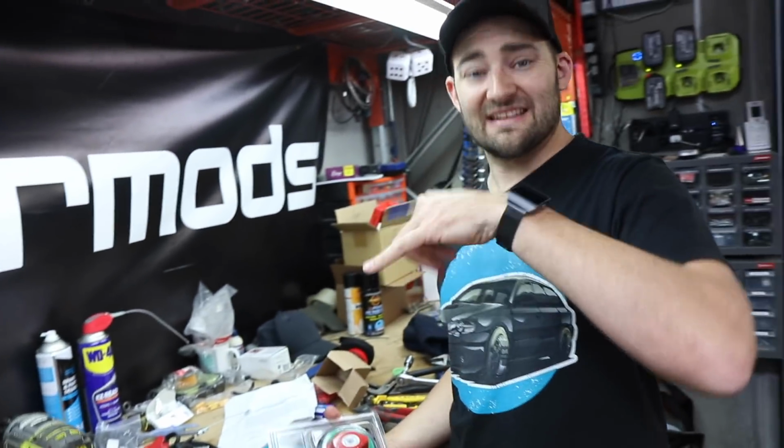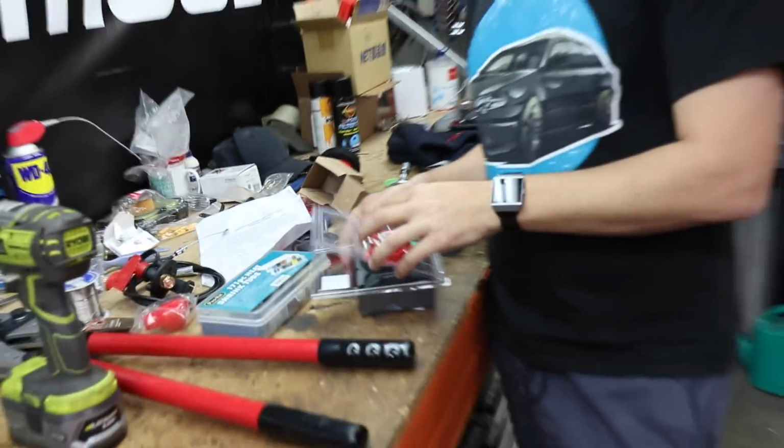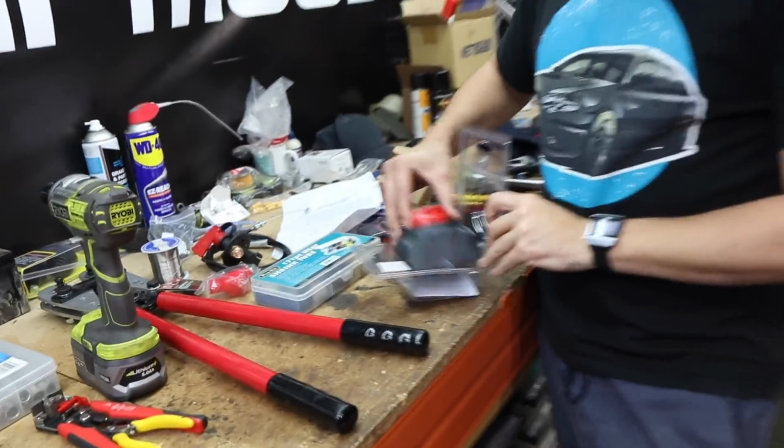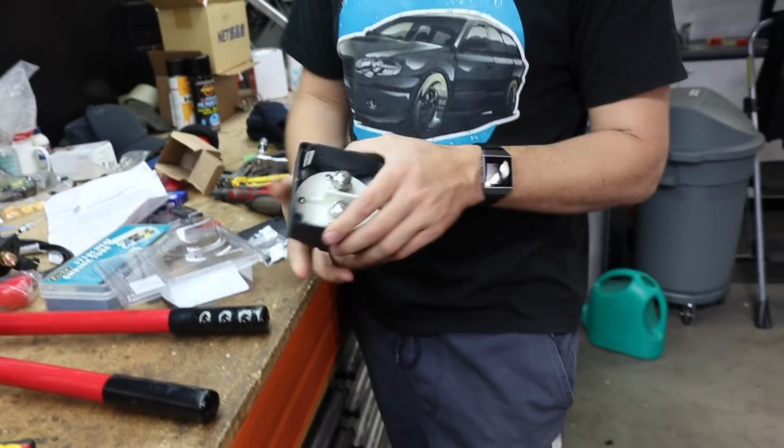So there are other options and other ways that you can disconnect power, and there's quite a few situations where you'd want to. For example, you're towing something, you've got a caravan, you've got an isolation switch, you want to isolate a second battery, so when you go out camping, you're just running your stuff off one battery and not killing your main one, so you can still start your car and get out of the muddy creek that you spent the whole weekend at. That's one such item. That's just a massive, heavy-duty, single pole switch that just turns a battery on and off.